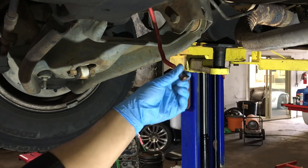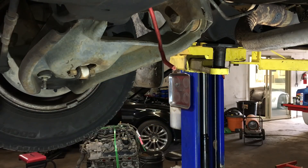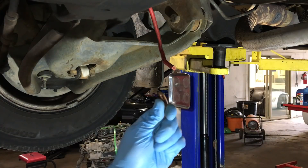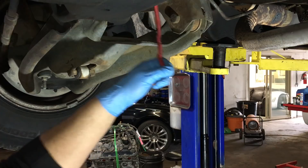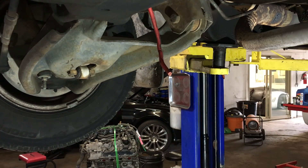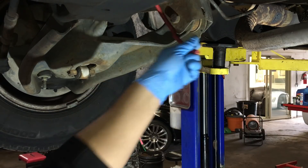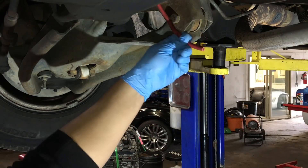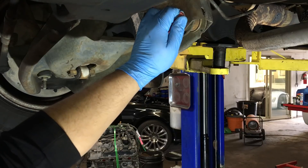That's pretty much exactly what happened here — the copper terminal I attached eventually came off. It did take four years, but whenever I attach one of these I want it to be permanent. From my experience, soldering alone is not going to be good enough when the cable is attached directly to the motor with a lot of heat and vibration. Coming around to do this a second time, we're going to not only crimp it but also go the extra step and solder it.